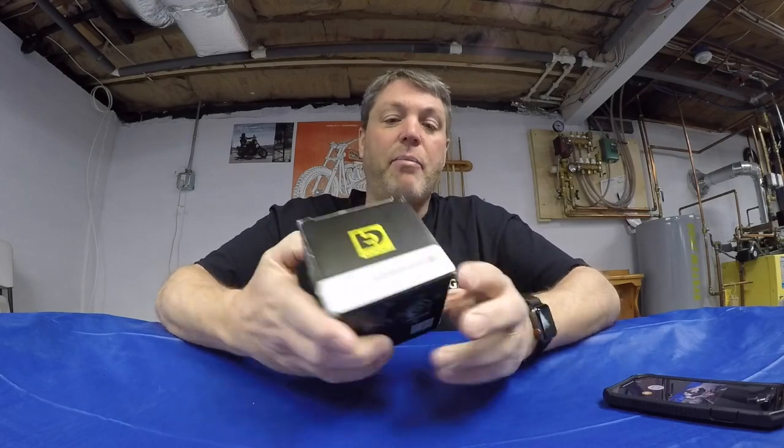Okay, so reading on the box here, it says the standard horns are about 100 dB. Other aftermarket horns are about 110 dB, and this Denali SoundBomb Mini should be 113 decibels, and that's at 3 feet away from the horn. The product specs: sound output 113 dB at 3 feet, current draw 5 amps, CAN bus compatible, yes, single piece electromagnetic horn. So this should be just an easy switch out. So we're going to do that today.